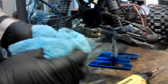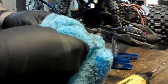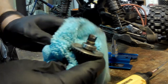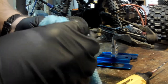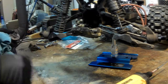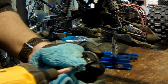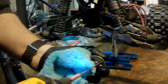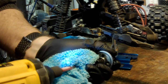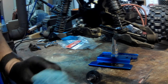For this step you're going to want to get yourself a good pair of latex gloves — it gets a little messy mainly because of the grease in the diff case. We're going to set the shim aside — definitely don't want to lose that. Try to clean some of the grease off this diff case with a rag. I actually had to replace the chassis on this truck about a month ago. You can see that's where the diff cup broke — snapped right in two. I greased this nicely; I use Lucas Red and Tacky, you can use anything that works for you. To open it up you've got four screws — I always like to go across from the last one I took out.